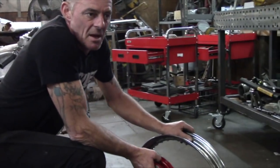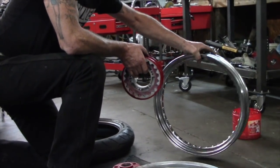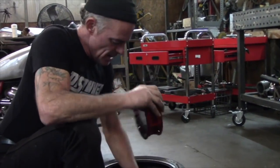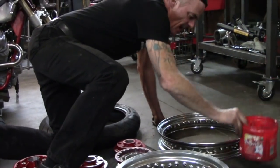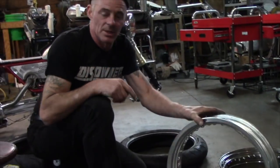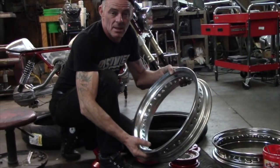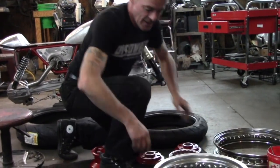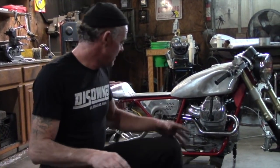This is a late 90s, early 2000s Moto Guzzi front wheel - it was an 18. I wanted a 17, but I worked it out. I took this hub - the one I faced off - and robbed the spokes out of it, which should be the right length because it's a drop center, to go onto this DID aluminum rim of the right width, 17-inch, that I got from Prince Albert, Canada, believe it or not. Just waiting on one rim now - from WUSA out in California, Josh, thanks a lot. According to my tracking, I'll have it soon, and then we'll start putting the wheels together.